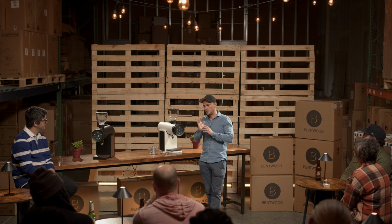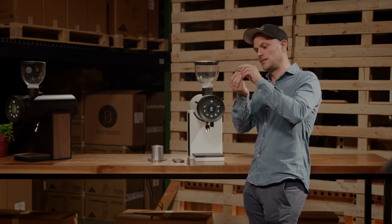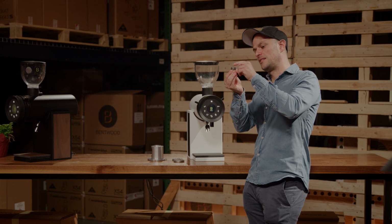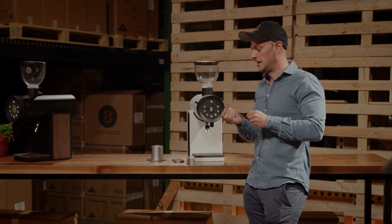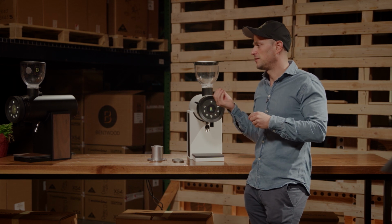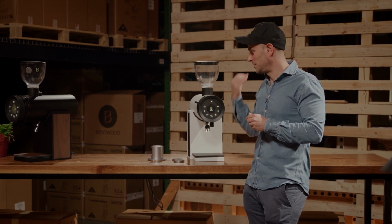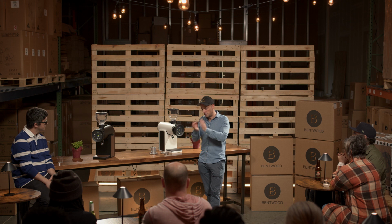And then as it comes to the spout, to avoid static loading, it has a little anti-static plate, which looks like this. Basically this is covered by the grinding chamber. These little fingers keep vibrating and they release the coffee. And that is killing the static. That is one of the key things. We have some customers that do take it out and they prefer just to let it flow, which is a personal choice. RDT technique is popular with some people. It's a personal choice. I think best is to leave it in. It does a great job and it really helps to keep the flow really neat.